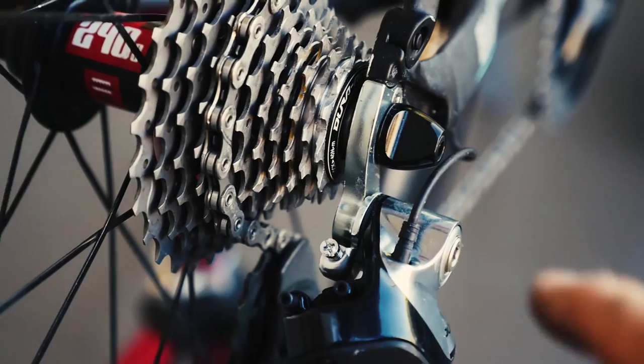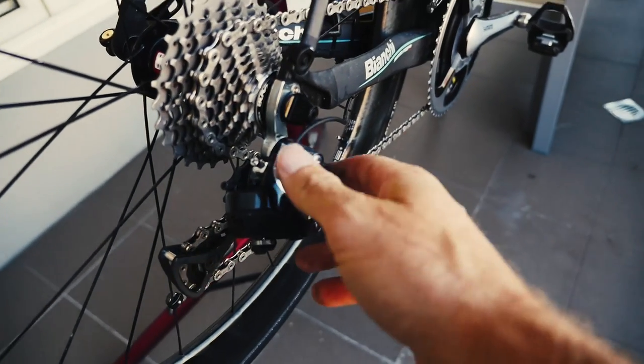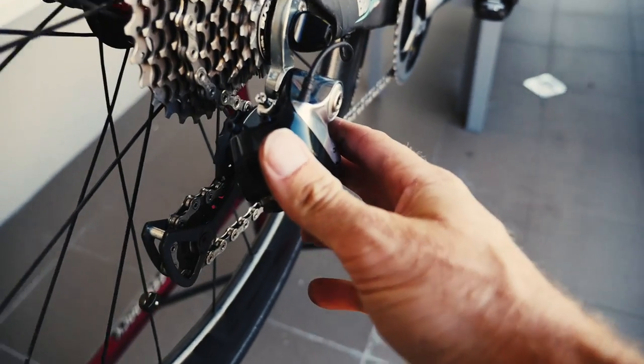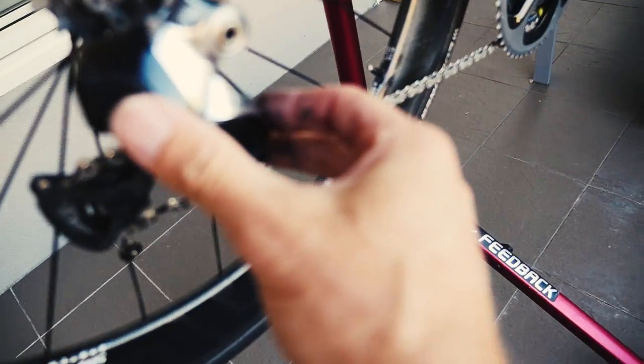So that's it for how to put the brake pads in — just a little tip for today. You want to protect your carbon wheels, so don't be lazy: regularly check and change your brake pads. Another quick tip: if you want to take out your rear wheel, always put the chain into the 11 sprocket, and as you're taking the wheel out just grab the derailleur and slightly pull it back.